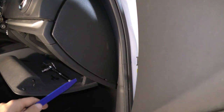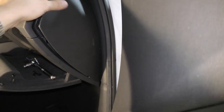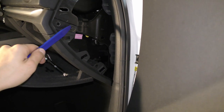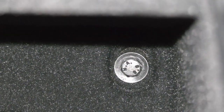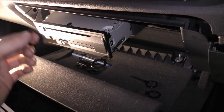The next step is to remove the side cover right here with your trim tools. Pop out this cover, and then you're gonna remove that 8mm or 5/16 bolt out. And inside the glove box, you have to remove that 8mm or 5/16 bolt out. Remember, I will be providing all the buying links for these tools in the description below.